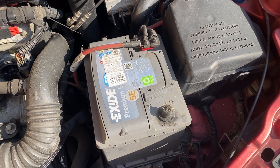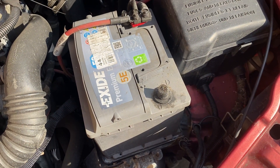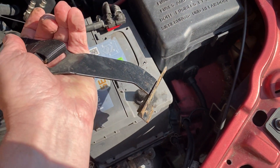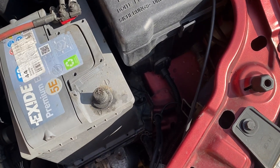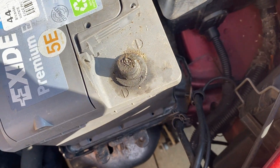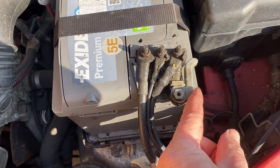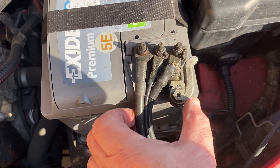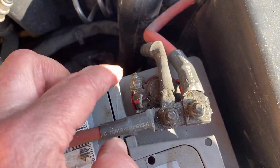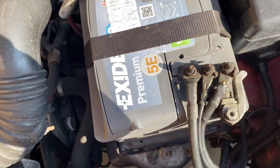I've put the tray in, tightened it with three bolts, and put the little plastic tray in - there's a little drain pipe on it as well. Connecting this up now - make sure you always connect the retaining strap down to there. If you don't have that strap properly secured, that's an MOT failure. Make sure the terminal clamp is adequately tight - the last thing you want is that to be loose on the post. Check that you've tightened up the strap and the battery is in place.